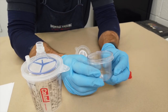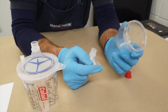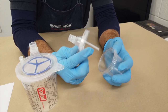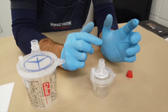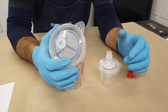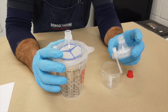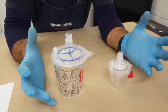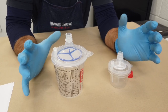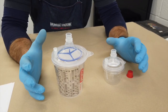When you mix your paint, they've got a little cover that can go on the cup so you can give it a good shake and mix it before putting it on the gun, or use it for storage. I haven't got any of those yet — I'm waiting for some to come in, and I'll post a picture to my story when they do. In terms of microns, I've got the blue one here which is the 130. The 130 and the 90 are the ones I go to — I don't do a lot of 2K priming, so I probably wouldn't use the 190s or 280s.